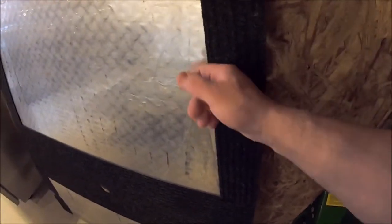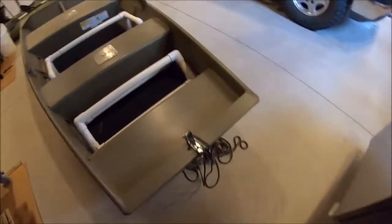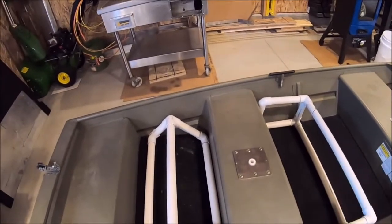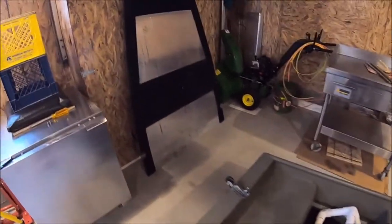So I cut these out, siliconed them down to the plate. I did it all along the edges too. This is the back seat here, and that's the back edge. And I left this overhang the plate maybe about 1/4 inch is what it feels like. That's so when I'm putting this plate in, it's heavy. I'm not scratching my rail. I'm not scratching across the top of my seats. I'm not taking paint off my boat. And it'll be quiet when you're walking on it. It's a cushion.